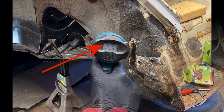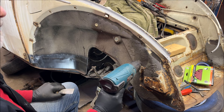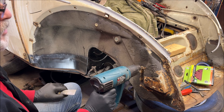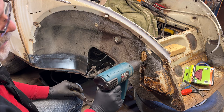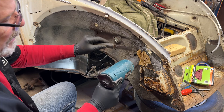It's 1200 degrees. I put a little piece of board down here to catch some of that. Don't touch this end of the heat gun — but I guess you know that. We're going to heat it a little bit, because if you try using a wire wheel or sandpaper you're just going to gum it all up immediately. Watch if you have your gas tank in your car and a heat gun — that doesn't mix, so be careful with that. Look at that — it literally just peels right off. This undercoat has been on here a long time. I'll speed the film up in a second — I'm just showing you why while I can talk.